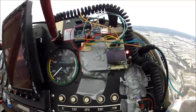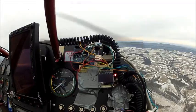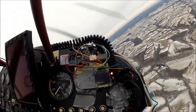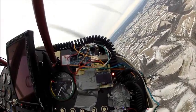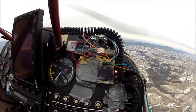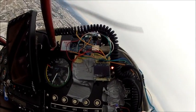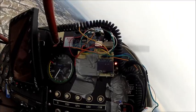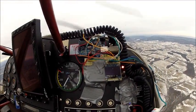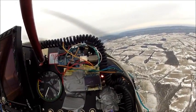What it's supposed to do is give me attitude indication, which you can tell it doesn't do. Even when I roll the plane, it appears to be reading something, but there is far too much noise in the power supply, and also the mounting. I've tried mounting it at different parts of the frame and the dash, and it doesn't really seem to do any good — but it was a fun project on the ground.